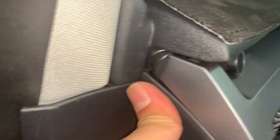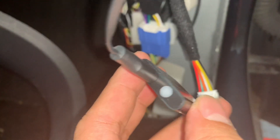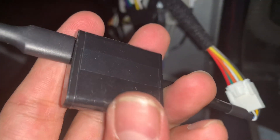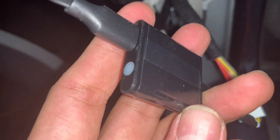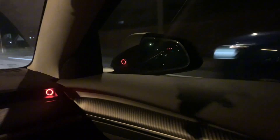Like the other side, you will see a little bit of cord here — you just use this prying tool to push that in to hide it. As soon as you plug this USB Type-C power cord onto this power box, this square power unit, you can tell the blinking red pops, indicating that there's power. If there's a car oncoming, it turns solid orange, warning me that there is a car on my blind spot on the passenger side.